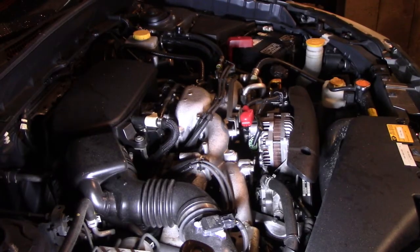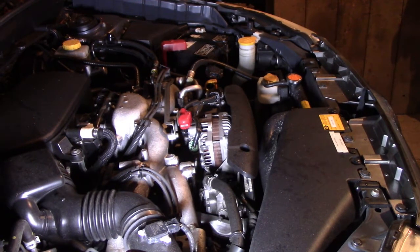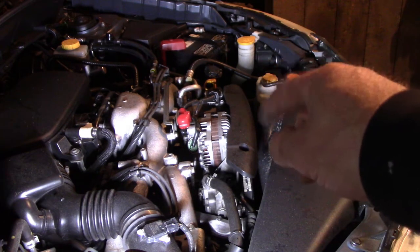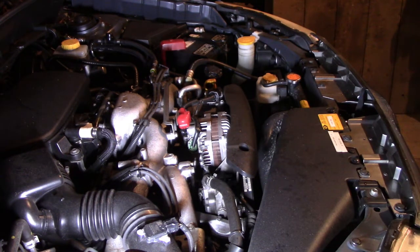Hey, John here. We're looking at a 2010 Subaru with the wimpy four-cylinder, the single overhead cam four-cylinder. The symptoms are the red lights flashing, which means it's overheating — not quite overheated but on its way. A solid red light means it's overheated. The coolant bottle has nothing left in it. I checked the upper and lower radiator hose and can't see any leaks, and it's raining now so I don't smell anything. Got to find out where this fluid is going and why it's overheating.